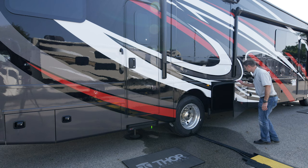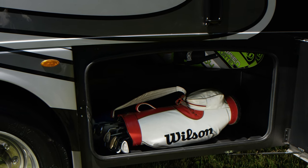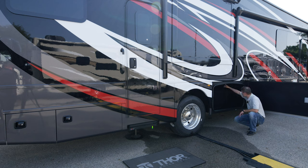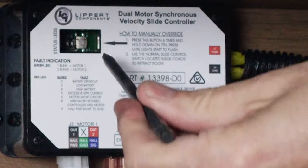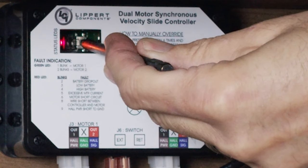Moving down the side, here is a very large storage bay — great for golf clubs, skis, or whatever you want, with a nice pass-through. This is also where the ladder for your overhead bunk is stored. You also have the brain for your slide-out motors here. If there is an issue with your slide-out — it's not going in or out, or got a little wonky — this is where you reset it. There are a series of codes it will flash, and you simply press it with a pen or small Phillips screwdriver: one, two, three, four, five, six, seven. Hold it on seven and it will reset the system.